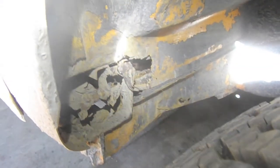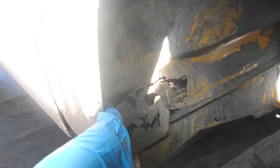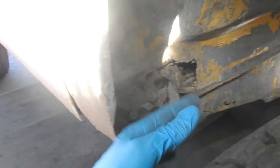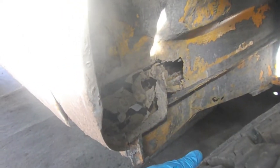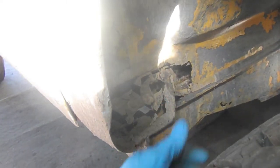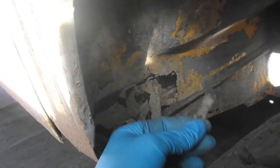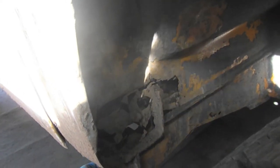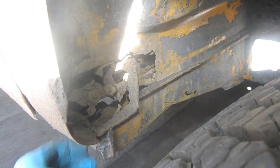There's some body filler stuff that VW puts right here — I can show you on the other side, which is in better shape. This side is so rotten. I was hammering the stuff out a little bit since it's rubbing pretty heavily right in here. You can see this metal is just so gnarly — you can just twist it off. I'm going to be cutting this entire segment out and replacing it with rectangular steel, and I'm actually going to move it back about an inch.